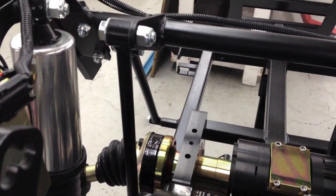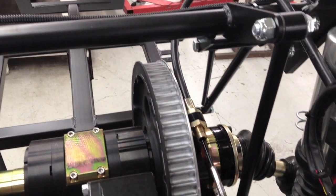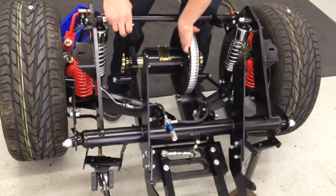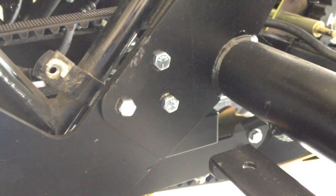You can see that the swing arm mounts in the same location at the back of the transmission and that it is held up in the rear of the kit via these vertical tubes. These vertical tubes have isolator bushings that allow the movement necessary for a rubber-mounted engine, as in the Harley-Davidson touring motorcycles. The entire chassis mounts to existing points in the bike and requires no cutting, welding, or other modifications for the installation.